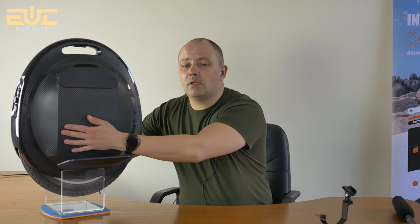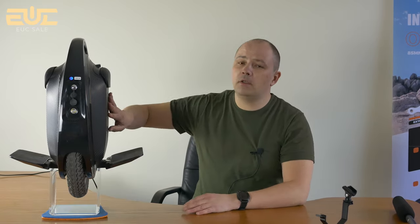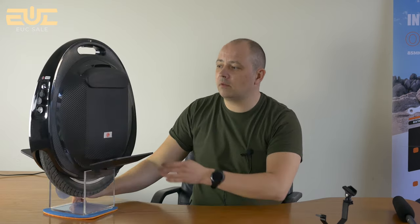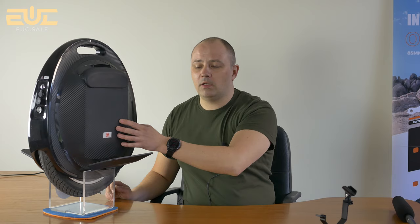About the body, these side shells are bigger now, as you can see, compared to the Tesla 2, because of the batteries, of course. Almost, as I said, 500 watt hours are here, and now we're using not the 18650 elements, but the 21700 elements. So another type of battery and bigger capacity here, bigger covers, and they made all this room here filled with batteries, and they even do not put the magnet inside the shell because of the room. There is no room to put even the magnet.